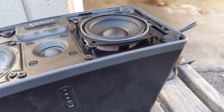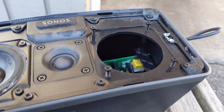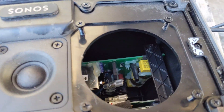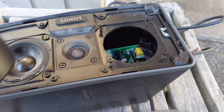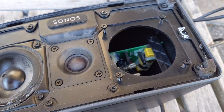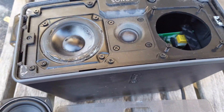What I'm going to do is take a quarter-inch plywood and stack it in there, make an adapter out of that, and seal it up. Because this whole unit is kind of neat — I was reverse-engineering how it works. There's a woofer cone in the back for the low end but nothing attached to it like a voice coil. My thought is they sealed the whole unit up, and the airflow from these two speakers drives the inside air for that 180-degree phase — that gives you the low end.